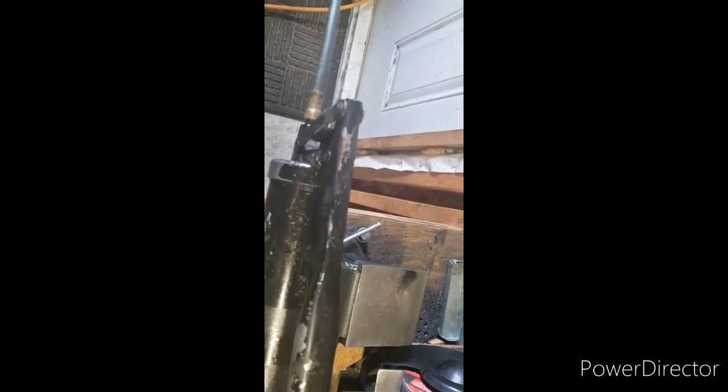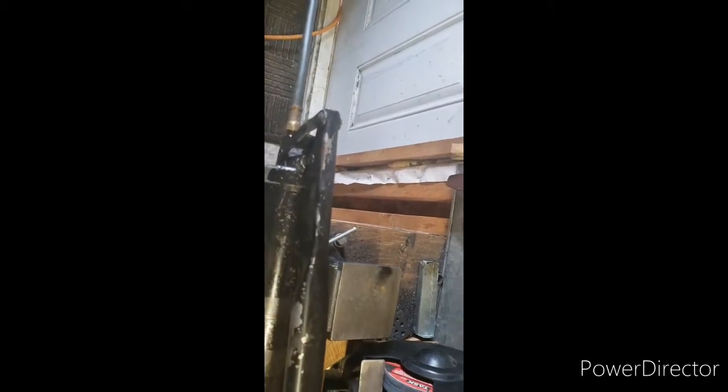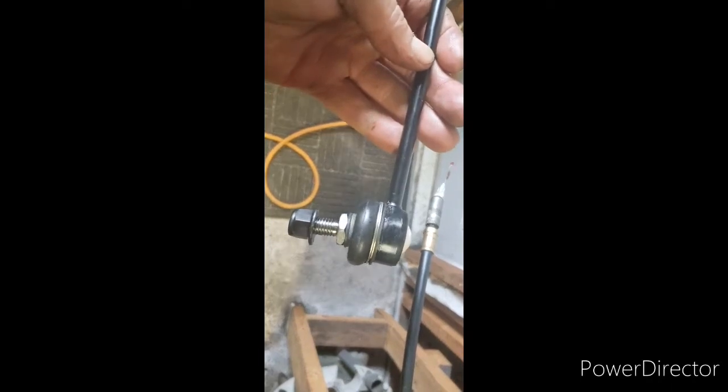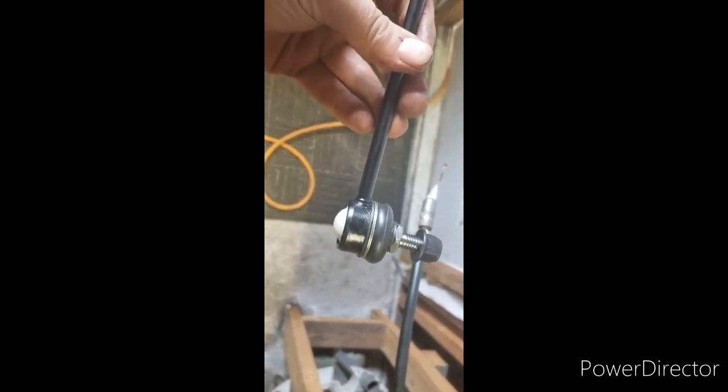So I just pump this up with my armpit as I'm holding this, and I fill this. You don't want to fill it too much, but you do. There wasn't hardly any grease in there at all, so you just pump that up. Put grease in. There's a fair bit of grease in there, but it's not bulging. I don't want it to bulge out because this is not exactly tight, right? It keeps the boot on, that's all, and that's the purpose.